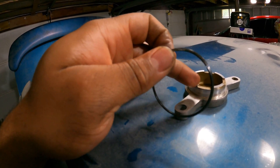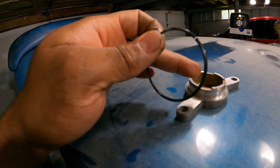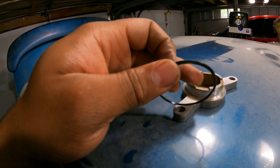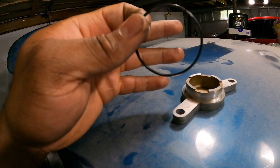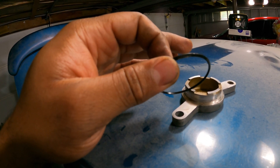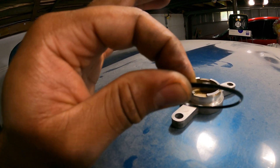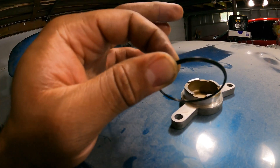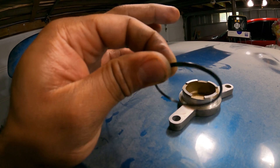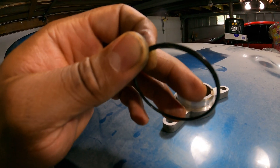We'll put the new seal around here and put this back where it belongs. First I'm going to apply some brake clean to the orifice where this came from and clean out any gunk, then put some fresh oil in there to keep it lubricated — because brake parts cleaner tends to dry everything out. You want to wait for it to dry completely before putting rubber seals back in place. You don't want brake parts cleaner contacting the seal while it's still wet or it'll start to degrade the seal — you'd be doing the job twice.